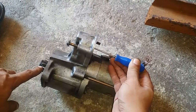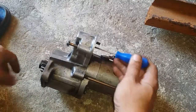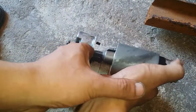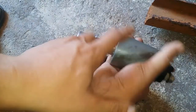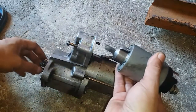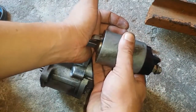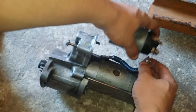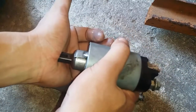Pulling this down is going to pull on this lever inside. When you pull on that lever, the pinion will stick out, engaging on the drive flywheel. And then almost simultaneously — although it happens one after the other in a very brief moment — soon as you turn the ignition switch on, it sends a signal here. It's basically a double-action solenoid: first thing is it pulls this piston down, and once that is done, it also acts as a relay that transfers energy from the battery towards the motor, making it turn.